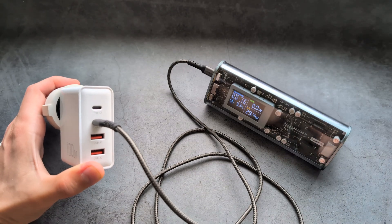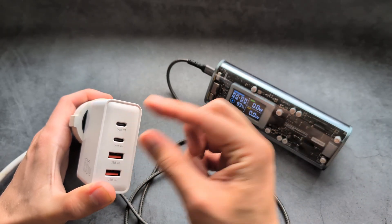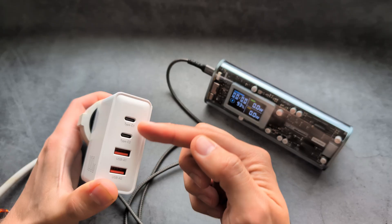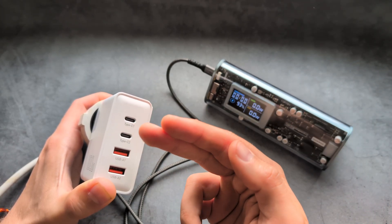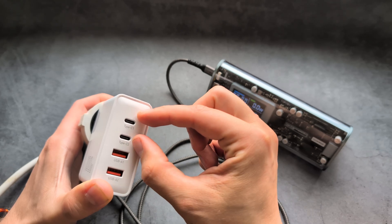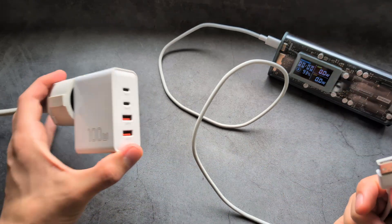When it comes to the total output for USB-C 1 and USB-C 2 combined, it's still 100 watts total. So you can get 100 watts from port one alone, but if you plug into both ports the combined output is 100 watts — maybe 70 on one and 30 on the other. If charging from both at the same time, make sure to plug the more power-hungry device into port number one.